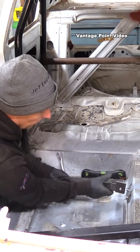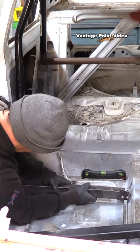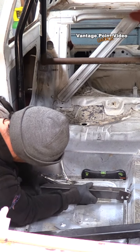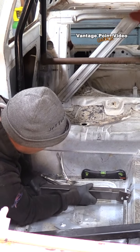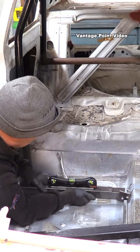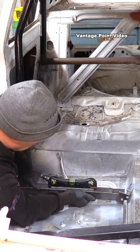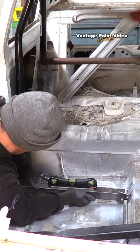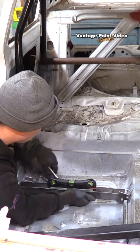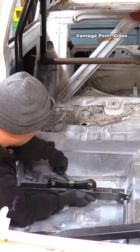The jig sits nicely — it goes onto the end plate that the transverse member will be welded to, and sits on top of the counter plates which I have to weld to the floor. Everything is taking its position from this. With the car leveled left to right, when it looks true to the end plates and level, I lock it in position using a vise grip.